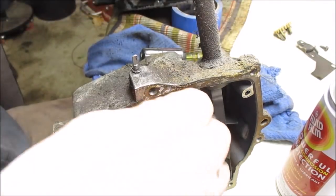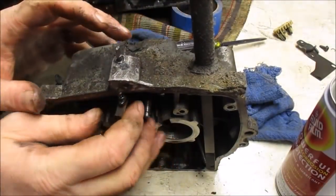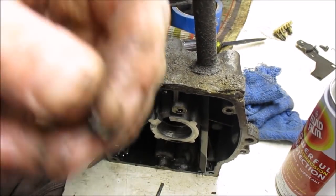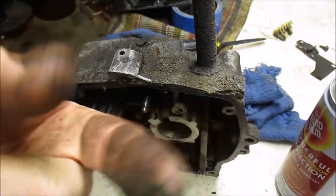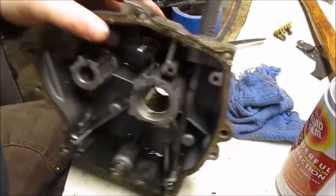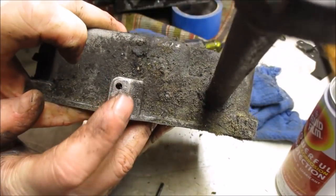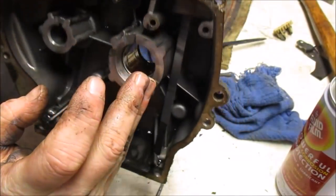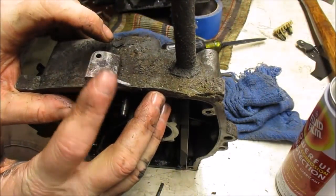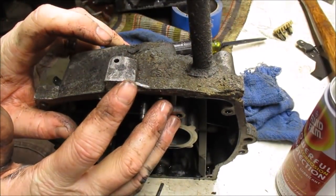Maybe there's more than one way to skin this cat. I don't need that snap ring, and it's being a pain — done. All that fighting and stabbing and a little tippy-tappy and it was all done. So that's the removal of the governor. We'll find something that fits in there and tap that, or I think on mine I JB welded a plug in there and it worked just fine. This should be all right — like a self-tapper with a rubber, or a self-tapper with some RTV.